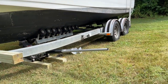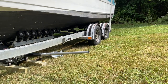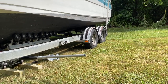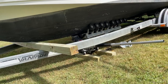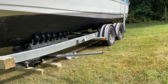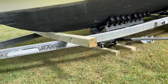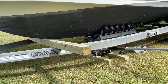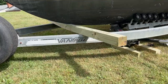I think it's a lost cause — I'm going to have to go buy some cinder blocks and block it. Put the transom, put the stern on blocks, jack it up, put it on blocks at the stern, pull the trailer forward and let the front of the keel rest on the rear rollers. That's going to be the only way, because if I put that jack on the center of the boat I have to be up under it jacking. And it's already bowing — the four by four post it's resting on cut right into it and it's bowing.